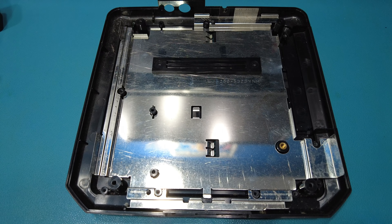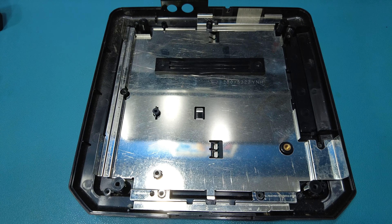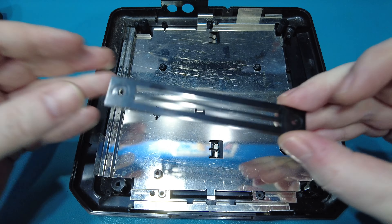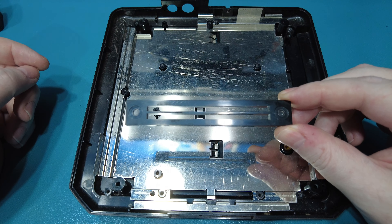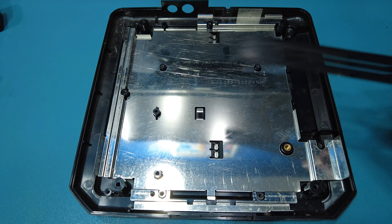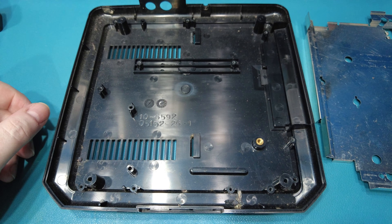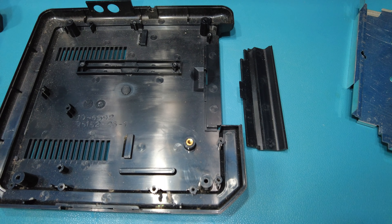What I want to do is strip down the case because it's a little bit dirty — you can see there's old dust bunnies in there, and I bet there's some from the 90s as well. I need to strip the bottom and top case down. Super easy to do. For the bottom case, I'm just going to remove the cartridge slot reinforcement — don't lose this, guys. If you lose this and you screw the Mega Drive back together without it reinforcing the cartridge slot, you can end up with dry joints, and then your games don't work anymore. The shield is super easy to remove as well — pull that out and that's the bottom half stripped down.